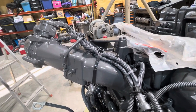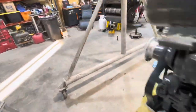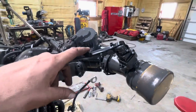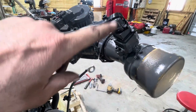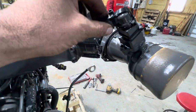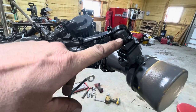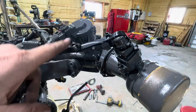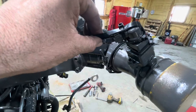I secured things up as good as I can. This mass flow sensor — new little technique I'm just playing around with. I've always used electrical tape to try to stop this fitting from moving. It'll just sit here and vibrate and the wires will wear right through. So I took a big zip tie and made a little stiffener, so I'm hoping it's pretty stiff now and won't vibrate around.